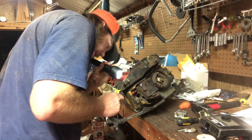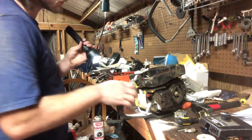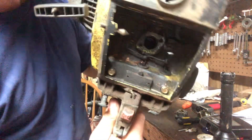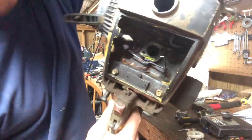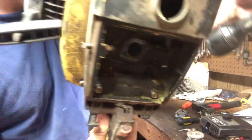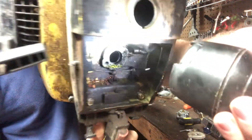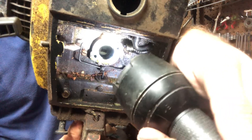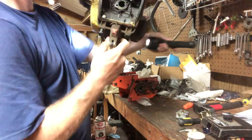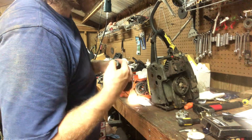That's going to be a good candidate for a sleeve. Wish I could show y'all that — I don't know if y'all can see it. What about pouring some of this nasty gunk? No, that's too bright. There goes some brake clean — y'all see down in there? That's scoring. Y'all ain't going to be able to see that, oh well. I wonder what our piston looks like on the exhaust side since that's what it looks like on the front side.